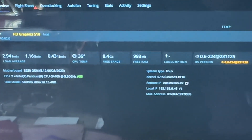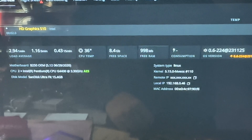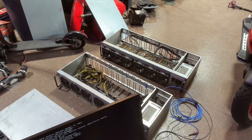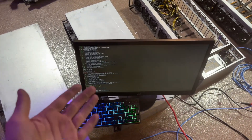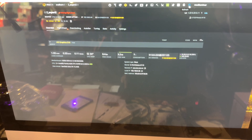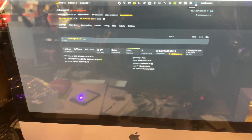All I had to do was change the rig config — it was pulling up the wrong rig. This one seems fine, which is great. Let me move the RAM over. Wow, it's one gig of RAM? No way. Okay so the RAM is fine — I did swap it over. It is DDR3 so it is possible it's a one gig DIMM if they just ran out of other stuff, but you wouldn't be able to run much for mining on a one gigabyte configuration.